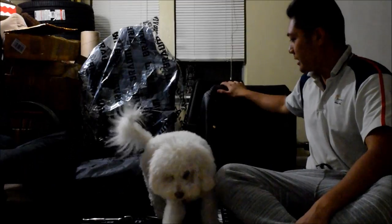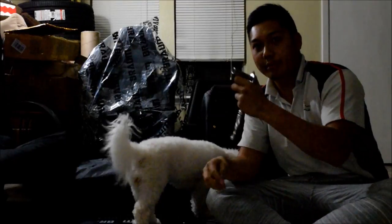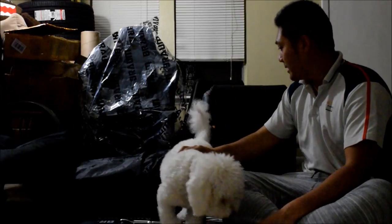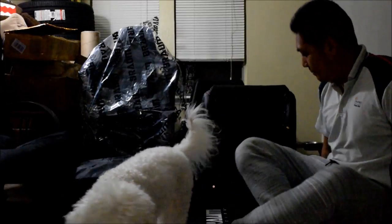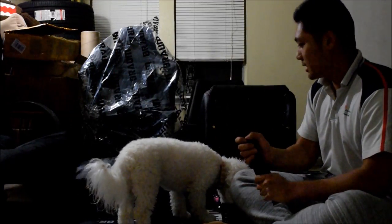It's kind of dark at night, but I'll go ahead and install the brackets and then show you guys how these seats look. I'm going to show you how to install the sliders onto the Braum Racing seats. All you really need is a 12 millimeter socket wrench and an allen key — that's it. In some off-market seats they don't drill out holes on the bottom, so you'd have to drill them yourself, but in this case the holes are already in place.